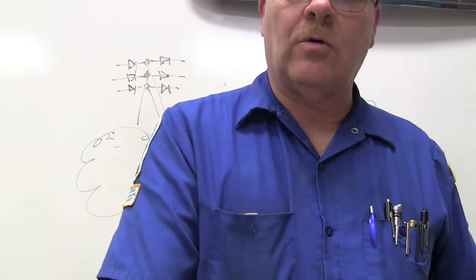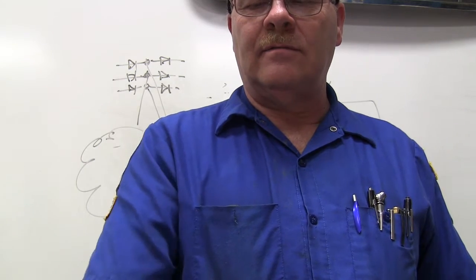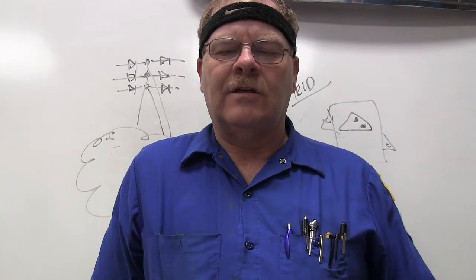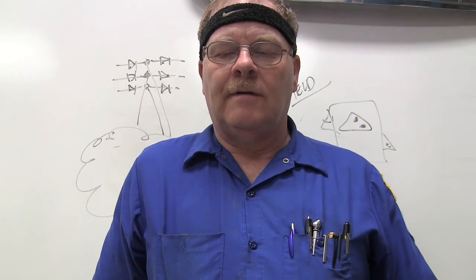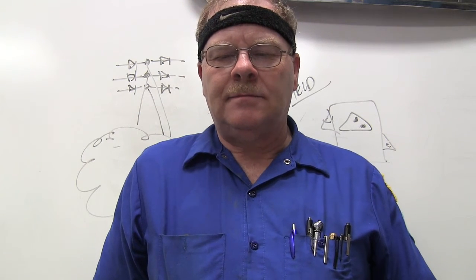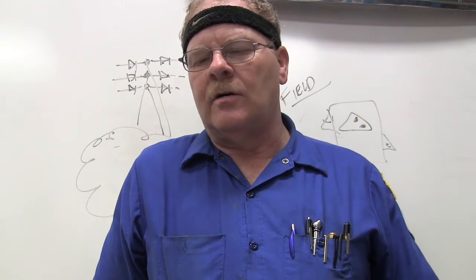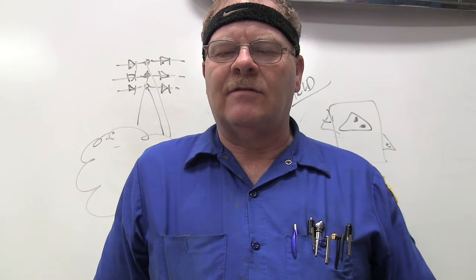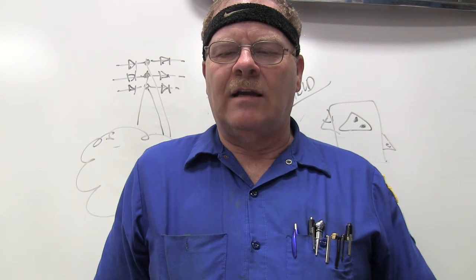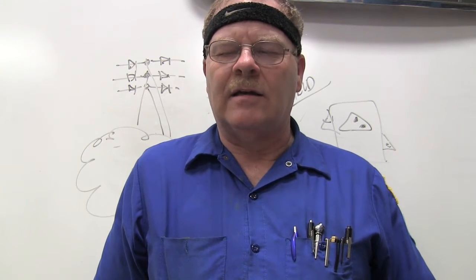Okay. So number 5, maximum alternator current output is limited for what reason? In other words, what is it that affects it as far as alternator construction goes? Well, sort of. You're close, but the size of the fixed stator is part of it. Remember this: the rotating rotor winding and the speed, which would be related to the size of the pulley.